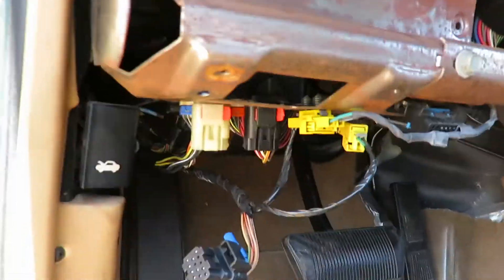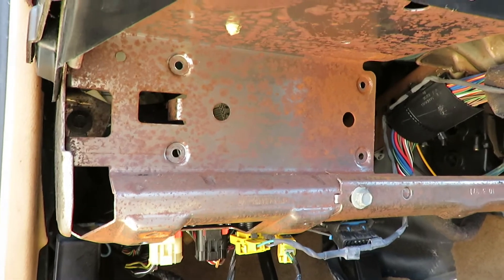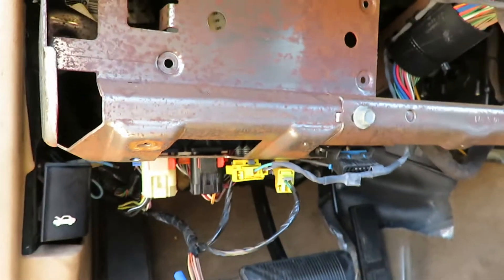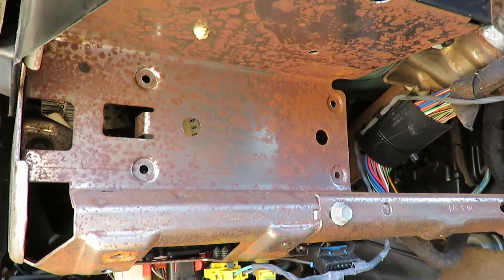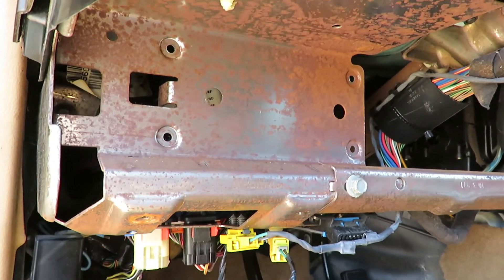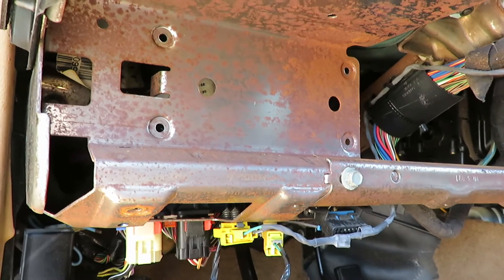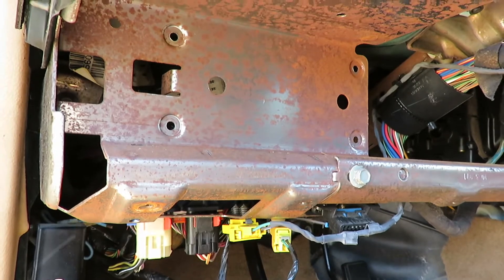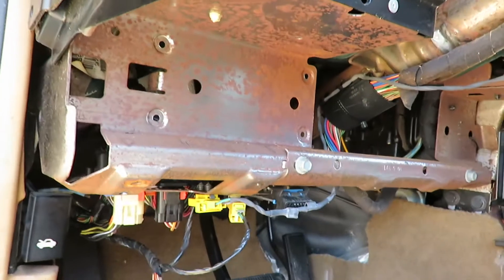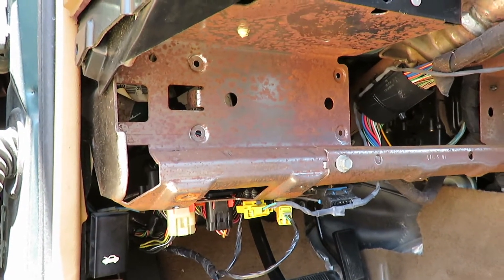To me, based on my electrical experience, there's something wrong in that BCM panel — I think it's responsible for the dome lights. So I took it out and ordered another one on eBay. My Jeep has a security system, so it's very important you order the same part number. I'm hoping that fixes the problem; if not, I'll let you know in the next video.